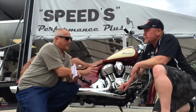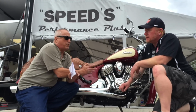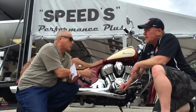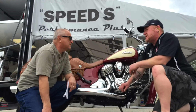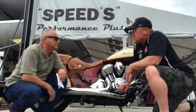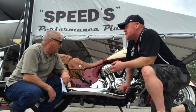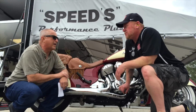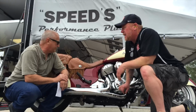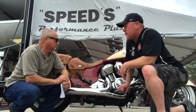I know you can't tell me because it's not here, but you think it's 111 cubic inch. Yeah. What would it be bored, like 120, 130? I'm going to say we'll probably have kits for like 120 cubic inch. There's talk maybe all the way up to real big stuff, with these cases. Strokers and things. Oh, yeah. All that'll be 130, 140, 150. And this head has actually been proven to handle up to about 150 horsepower with some work.